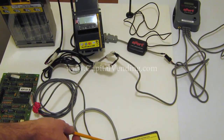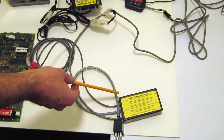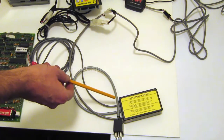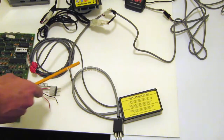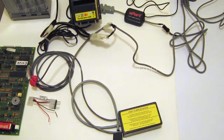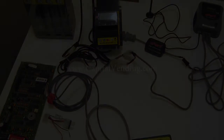This piece is the focus of the video — going from logic to MDB. We have other videos where if the control board already has MDB, it's a much lower cost interface to install MDB components. But again, if you have a dumb mech — a 12 or 15 pin dumb mech — you're often going to put this in. Our website has a listing of which machines require which kit, so it should be a big help in deciding what you want to do and how you want to put in your MDB components.